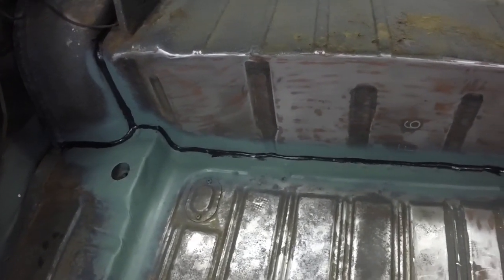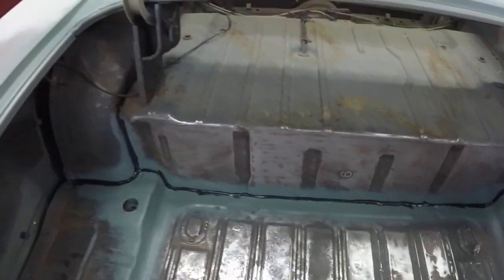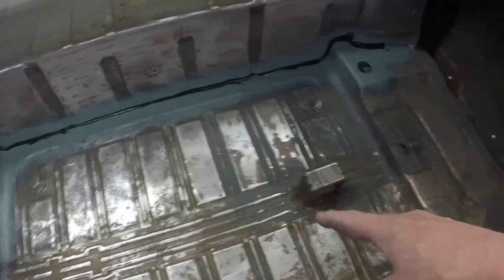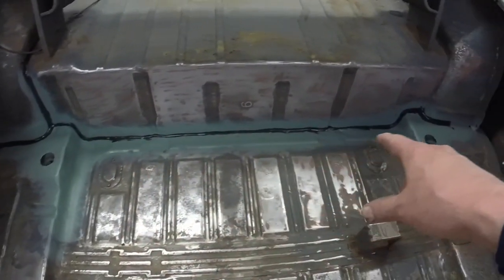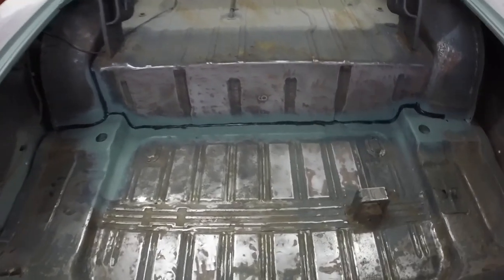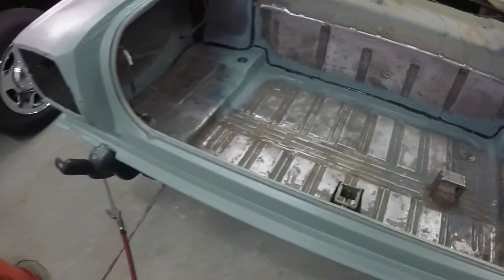out. And then I zinc chromate primed it and resealed it, and then I'll zinc chromate over that, or sandable primer over that. So I just got to finish sanding this out and sand out in there a bit, and just finish sand all those down. That's why I might prime the sealer so nothing sticks in it, and get all that sanded out maybe in a day or two if the weather's a little more cooperative, to stir up dust outside and maybe shoot some paint.